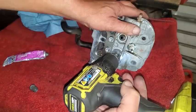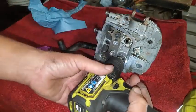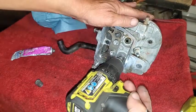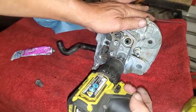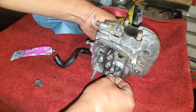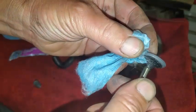You can feel when the grittiness stops and the grinding kind of stops — it'll smooth out. I'll push the drill up, turn it a little bit, then pull it back out, and you'll get the gritty grinding again. That's when it's lapping that valve seat. After a few times it stops, so you push it forward again, turn the drill, pull it back, and do it over and over again. You should get a good seal. I'm taking the lapping compound off and looking — it stays on there pretty good, so you have to wipe it off.